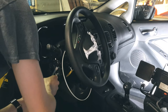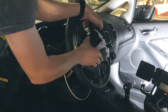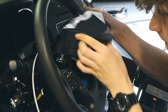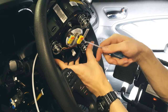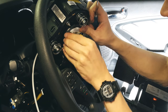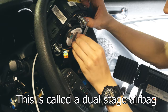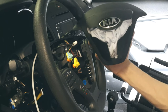This is way too easy — oh my god, that shouldn't be a thing. Like, your airbag should not come out that easily. These tabs are really common on this car, just to indicate that there's an airbag system that you're disconnecting, which is kind of nice. There are two connectors on this, which might mean there are two explosive charges in here. And there's the airbag, completely out of the car.